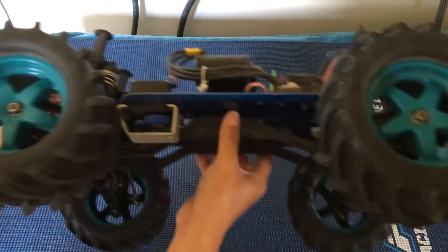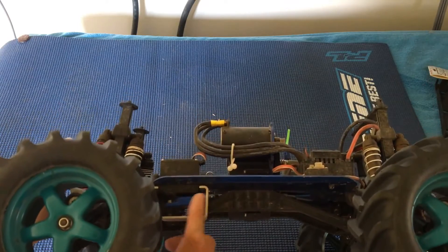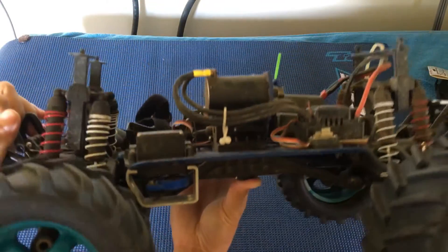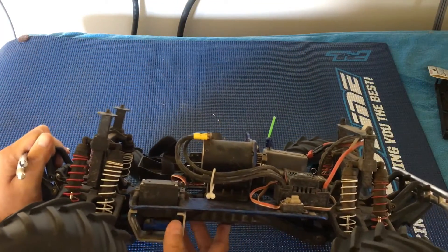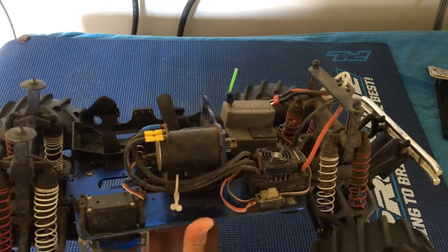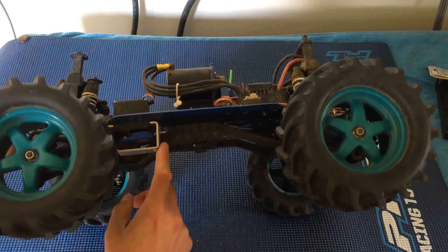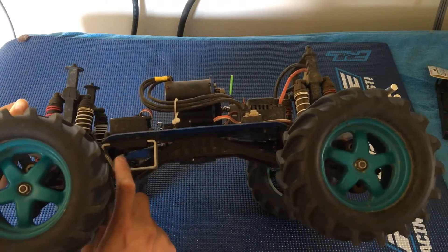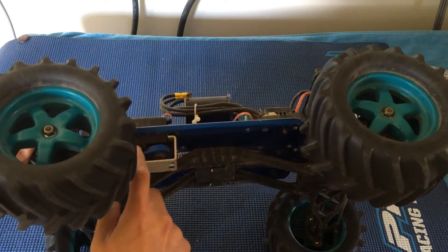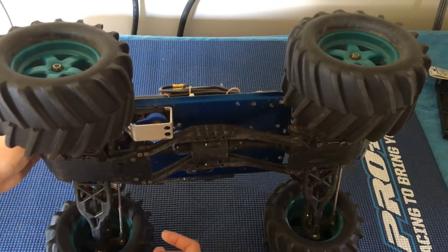We've had the servo give out too. The roller we bought came with a Hi-Tec servo and that one gave out. We replaced it with a Traxxas 2055 servo — not the best servo, but it was actually original equipment on the E-Max and T-Max. We also got an aftermarket guard that came with the roller, and we broke the servo saver too, so this is a newer solid one that doesn't have the spring in it. The trademark Traxxas one is white, so you can tell this has been upgraded.